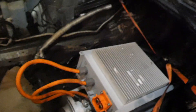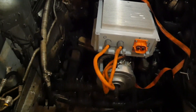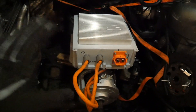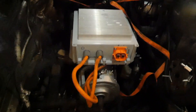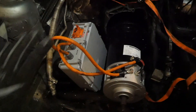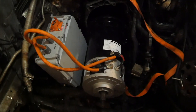Right now I actually have a pretty good handle on how things will probably fit in the car. Things are very much just in place for mock-up — this is not at all secured in any way, just held up by a piece of wood, but it allows me to get an idea of where things are going to fall so I can start to make a template and get things fabricated permanently. The electric motor is on the bottom and the controller is on the top. I've also considered mounting the controller up against the side of the engine bay, maybe putting the charger there and the controller on top — I think that's probably going to be the best.